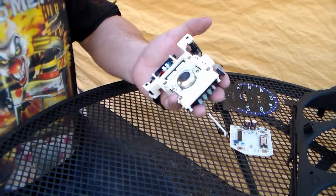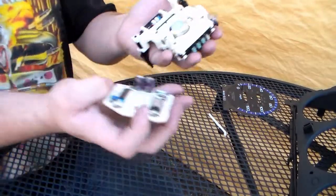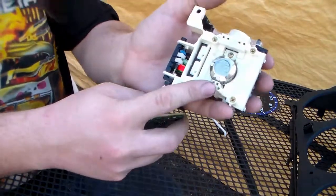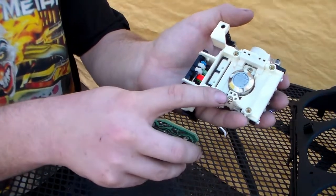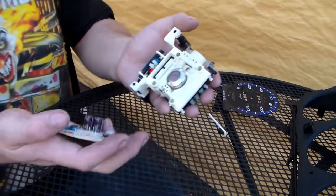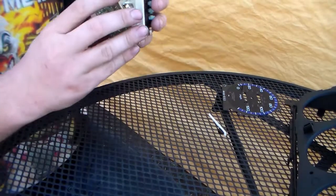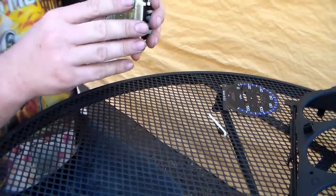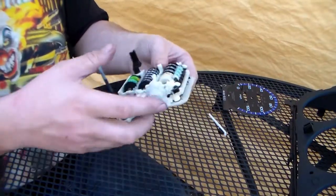Okay, so our motor's back in. We're gonna take our board and hook our board in. You can tell how you put your board back on, because there's four connectors here arranged in a pattern, and then there's four connectors across the top, and then you have corresponding pegs on the board. So you just get those lined up and it pushes right in, holds in with tension.